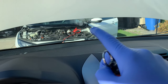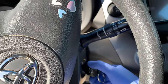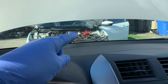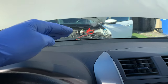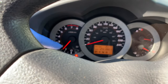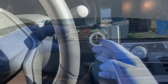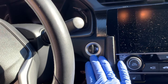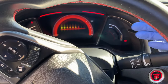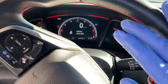Let's go ahead and start the good vehicle and let it run for a couple of minutes. What this is doing is actually charging that battery — you're using the alternator inside this vehicle to get some power into that one. If the vehicle is really dead, you might want to rev it up to about 2,000 RPM to get a really good charge. We're going to let it run for about two minutes and then test it. Now we're in the vehicle with the discharged battery, which has been charging for about two minutes — let's try starting it. As you can see, we've got full power and everything is turning on. Make sure everything on this vehicle is also off so we can get a good charge from the alternator into the battery.